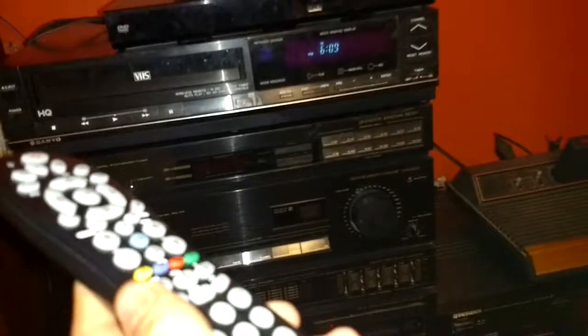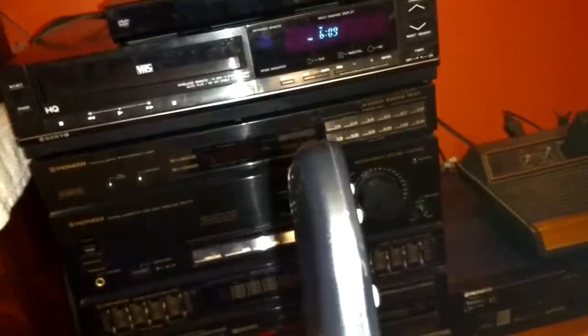If you get one of these and you have a flickering clock, you should replace all the capacitors in the power supply — it's just recommended, even though this is not like a Panasonic, I would do it anyway. I also replaced three belts. There were two for the loading mode because the motor's here — it has a little belt that goes here, and a belt that goes from here. They were loose.